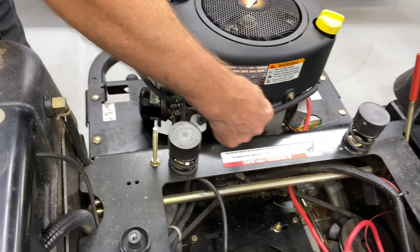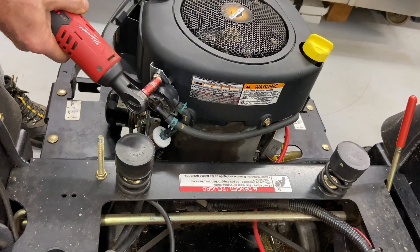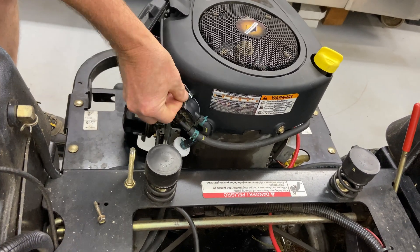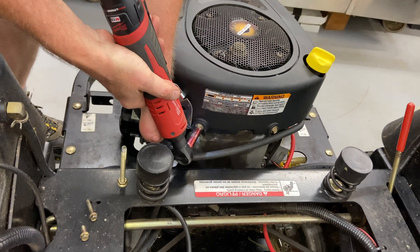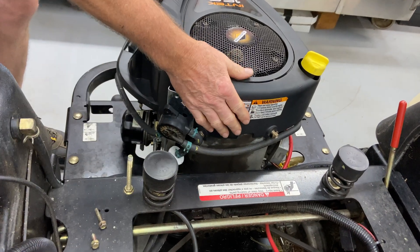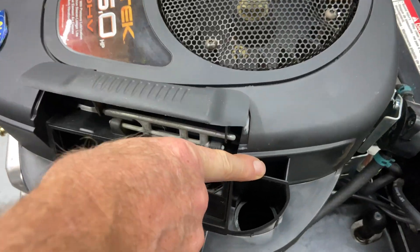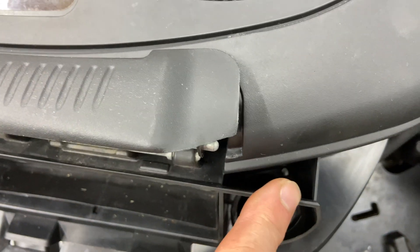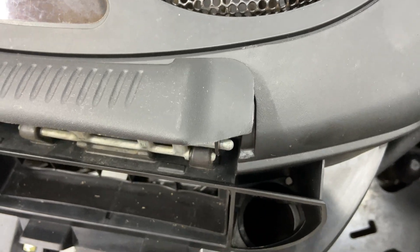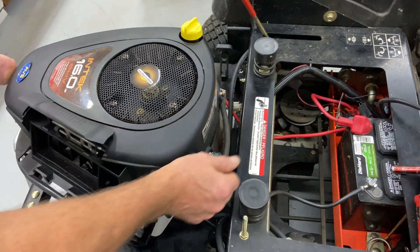There's one here — these are three socket. Take these off. I'm going to take the fuel pump off; if you do have a fuel pump, it's just easier to take these off. It's also easier to get to this one and take it off. There's usually a quarter-inch screw that goes into a hole right there that goes into a mounting bracket — this one doesn't have it, but a lot of them did. So make sure you check there before you take this off, or it won't come off. And it should just slide up.